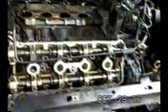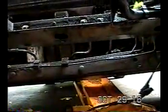Okay. I took the coolant reservoir out to give me some more room for later on, but the major project I just finished was taking out the front motor mount. This is really not any fun. The motor mount is gone now. You can see the exhaust manifold bolt and the right cradle bolt. Then the frame drops down a little bit, and that gives you the room to take this motor mount out. There's an 18 millimeter bolt that holds the bottom of that motor mount on, and then the rest are all 15 millimeter bolts. And that's what I want to show you, because this thing was not very fun to get out. It can be done.